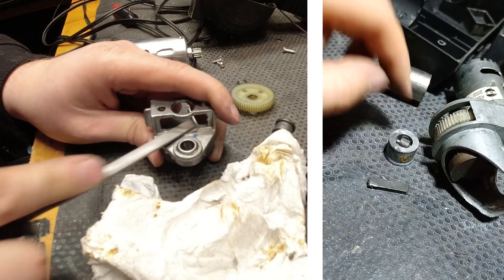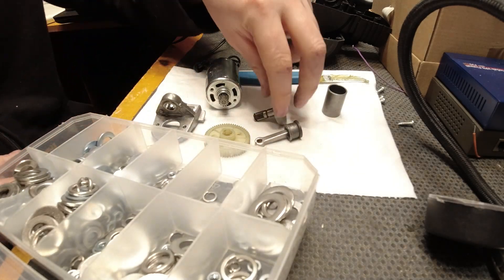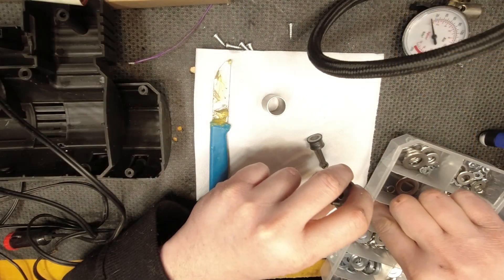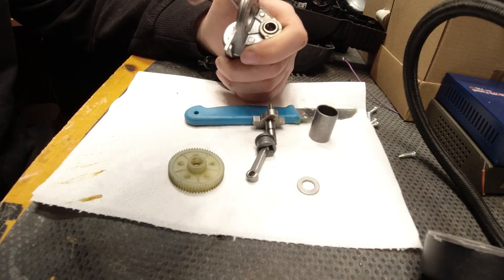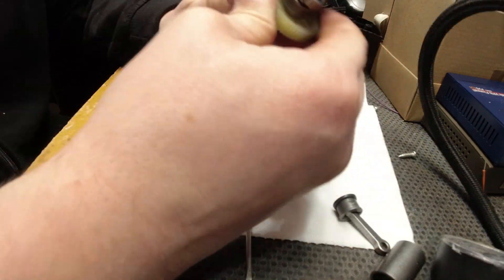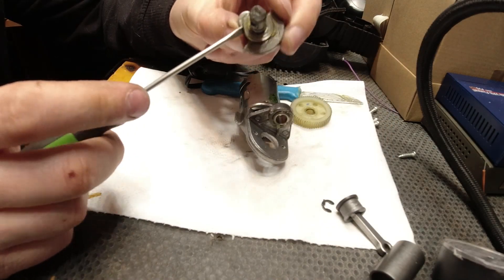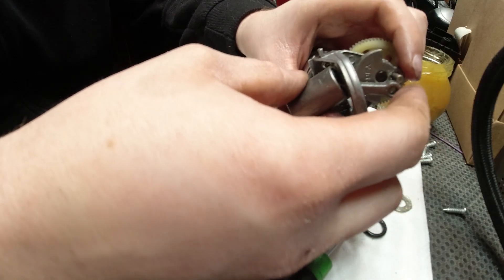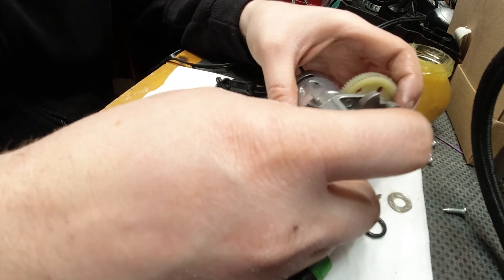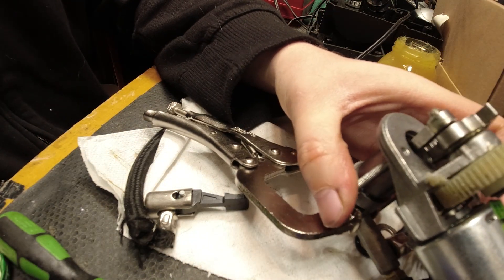It fell apart basically. It is also very important to mention for them not to work for a long time, because they overheat, especially if they do more pressure. After I clean everything I tried to reduce some tolerances by placing a washer, but I quickly realized that this was a bad idea. Because the gears were so stiff that I could not turn it at all. So I put everything back to how it was and just lubricated the whole mechanism.